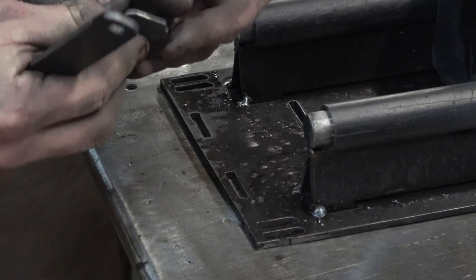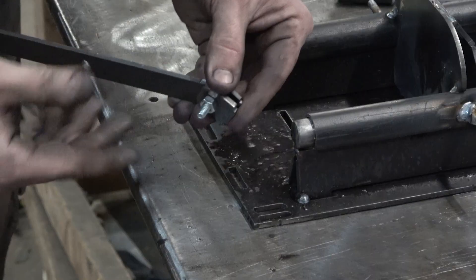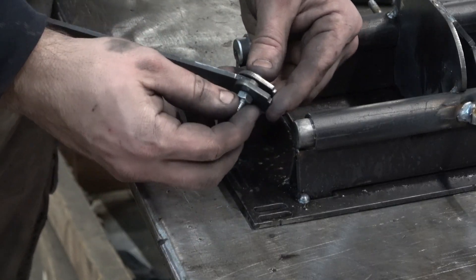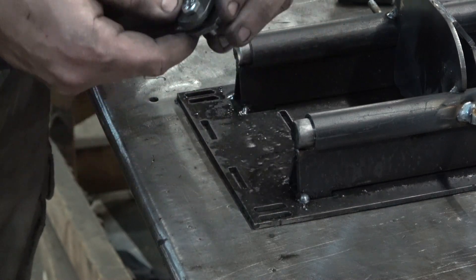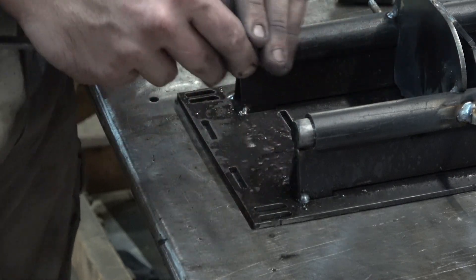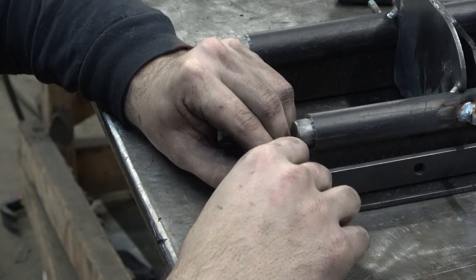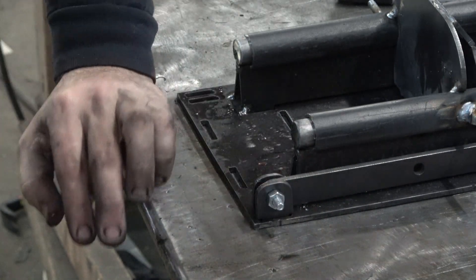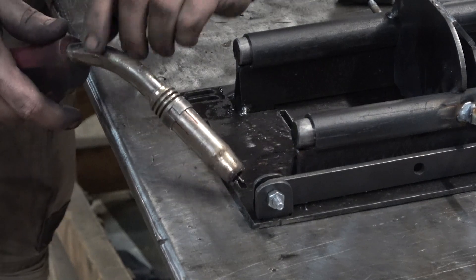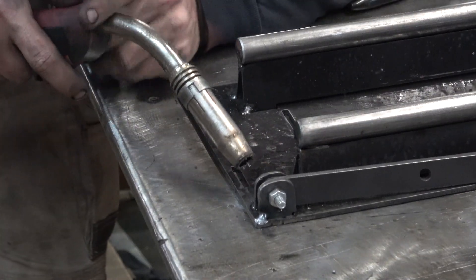Now we're going to put in these two little carrier pieces that hold the arms — it's just like this. Run a bolt all the way through. With the kit you're going to get six lock nuts and one regular nut; the regular nut's for this step. Thread it relatively tight, then back it off a turn or so. You're going to take these two little arms — they've got ledges or divots on them — and drop them into the holes here. Loosen everything up until they start to fit real nice. Adjust as needed, tack them into place — only tacking at this point. Make sure your arm swings totally free, then weld these out right away.